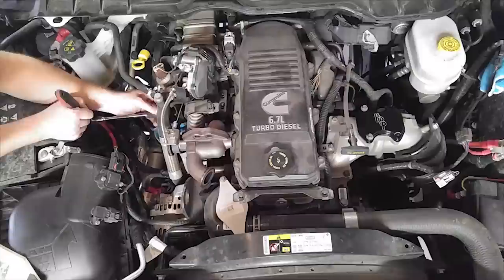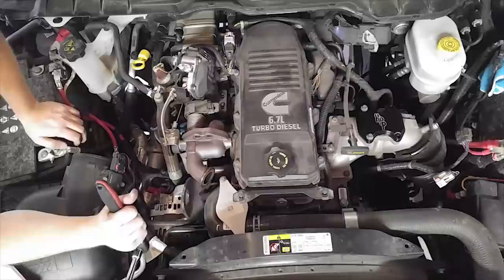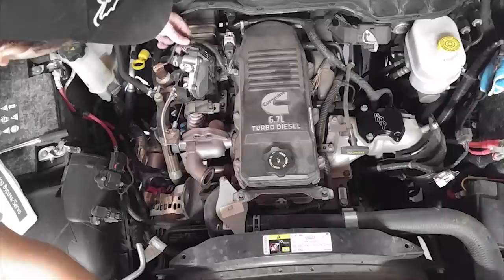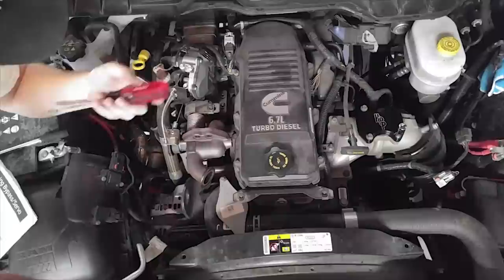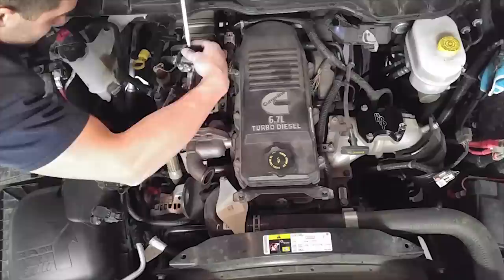After being cooled, there's a tube that crosses from the EGR over into your air intake horn. The air intake horn has a flange in there that moves back and forth and lets the exhaust gases flow back into your motor. This isn't a very good thing because nobody wants exhaust gases flowing back in — you get warm, unfresh air, so you're losing power. That's kind of why they make cold air intakes, but for some reason they put these things on the truck from the factory.